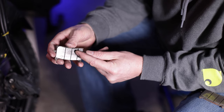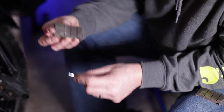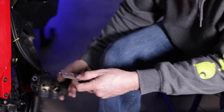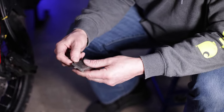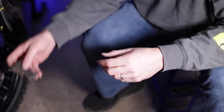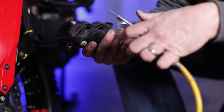For the two people watching who like the dentist, this is going to be really fun. Just be careful — you don't want to score your face, so just get down in the groove and clean out that area. It may be a good idea to remember which side the pads came out on. They seem pretty even so tracking which is right and which is left wouldn't be a terrible idea, but I did not do that. Next I just take some compressed air and use that to clean out any brake dust.